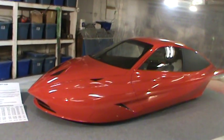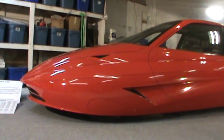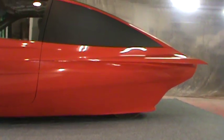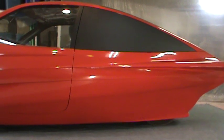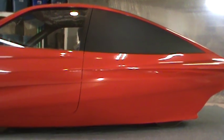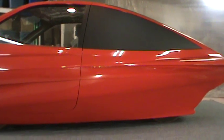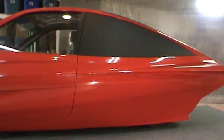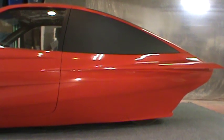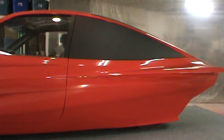There have been questions about how you get the tires off if you get a flat tire. If you look carefully at the front, you'll see the body line showing the skirts that will be removable, coming around to the back. That skirt is going to wrap around the front of the tire and taper up into the underbody Venturi. The area in front of the rear tires will be a diffuser on both sides to let air flow out from underneath the car. The underbody is a Formula One styled underbody Venturi — the faster the car travels, the more downforce it creates, and that downforce only creates 25% of the drag of wings or spoilers doing the same job.